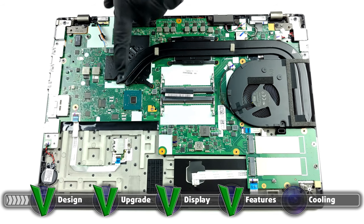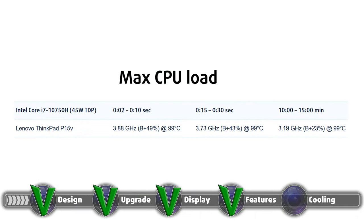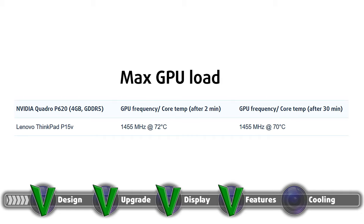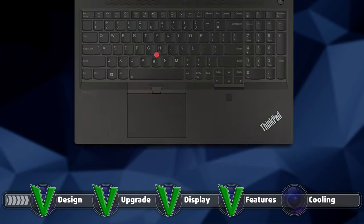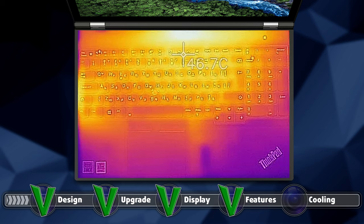The cooling solution consists of a total of two heat pipes, which doesn't seem to be enough for a Xeon CPU and a Quadro GPU. The CPU reaches 99 degrees Celsius in the first seconds of our stress test, and maintains it throughout the entire test, while the clock speed slowly diminishes, ending the test running at 3.19 GHz. The 40-watt GPU is pretty easy for the cooling to handle even after 30 minutes of testing. The Quadro P620 maintained a steady temperature of 70 degrees Celsius. Even though the laptop has a single fan, it can become quite noisy once you apply a heavy load to the system. Also, image rendering or gaming will leave the keyboard pretty warm, as we recorded an outside temperature of 46.7 degrees Celsius.